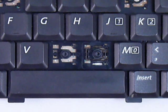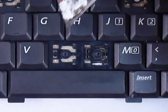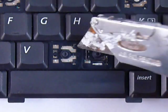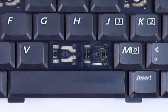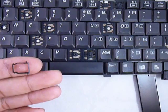We're going to install your keys onto your keyboard. Start out by looking at the plastic pieces that are on your key. On the left there are two hooks — those are going to grab onto your plastic pieces — and on the right, up and down, there are two clips where your pieces are going to click into. Right now we're going to click both plastic pieces together.